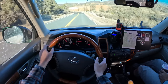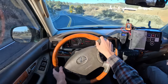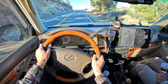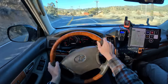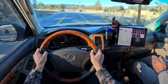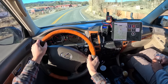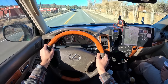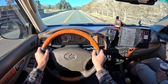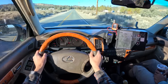No sway bars. You can really feel the wide track in something like this — it's a little unnerving to get the body to sway, but it's still planted. You just let it settle in. She can be a little top-heavy so I've got to be a little more gentle on the street, but on the off-road she just thrives. That's where this shines. The 4.56 gears help with acceleration given the extra payload. I average around 11 miles per gallon — that's about what everything lifted on big tires does.